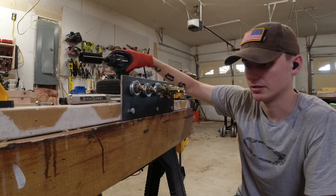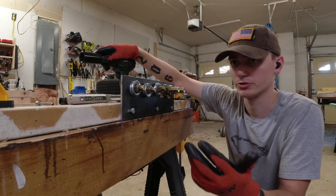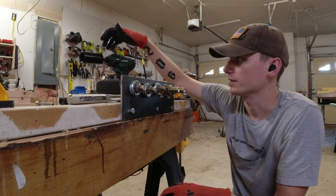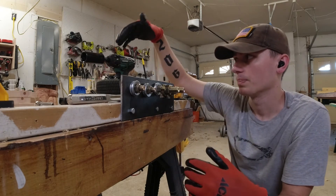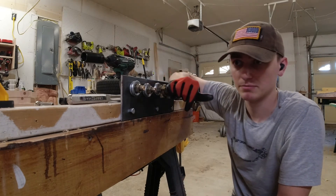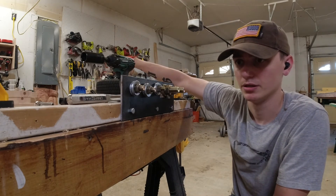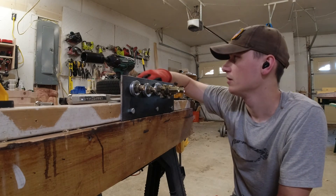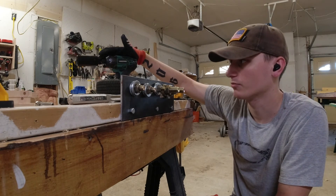This tool is more than capable of taking off lug nuts on any small vehicle — pickups and cars. When you get into more industrial or commercial settings like semis, you're going to want a dedicated half-inch impact gun. I have another MasterForce impact gun that's brushless with different speed modes — the lowest rating on that one is about 250 foot-pounds and it goes up to 500. I won't even be able to test it because my torque meter maxes out at 250 foot-pounds, so on the lowest setting my half-inch wrench would already max out the meter.